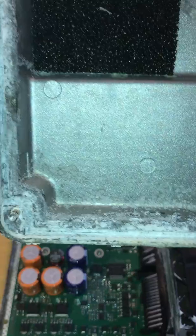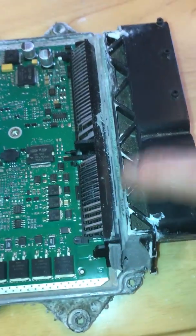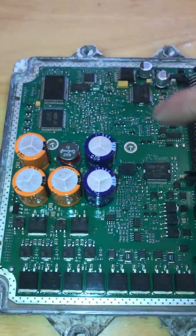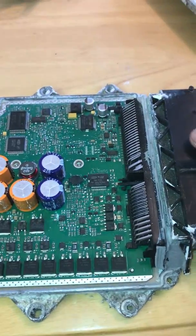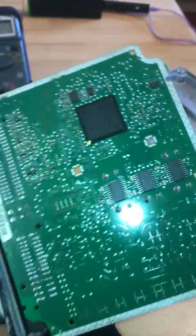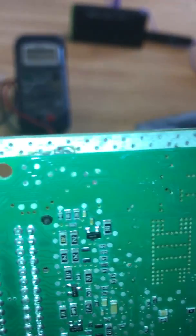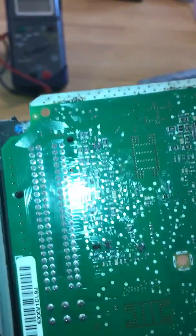So the top cover comes away like that. As you can see in there, the corrosion has gotten inside. That side's all fine — that's what it should look like — but that one side there, look, it's gotten in there. This doesn't look too bad overall. There are two little screw holes which fix the ECU board onto the bottom plate — you can take those off so you can see both sides of the board. I've seen some of these ECUs completely rotten. There's a bit of muckiness at the top on that earth strip, and I've seen these pins corroded so badly they pull out.